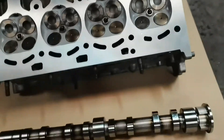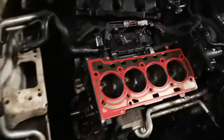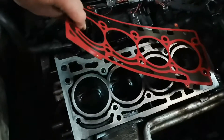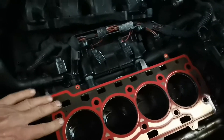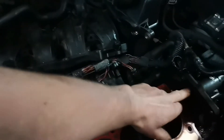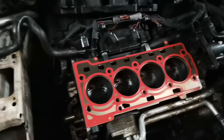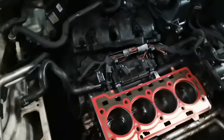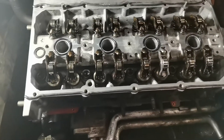Over near the car, everything is all cleaned up. There's a new head gasket, the deck of the block has been cleaned and is ready to build back up. The dowels are in place ready to locate the cylinder head. New gaskets on the inlet manifold are going back in, and then I'm going to build it all up and show how to put the timing tools in to set up the cam chain.